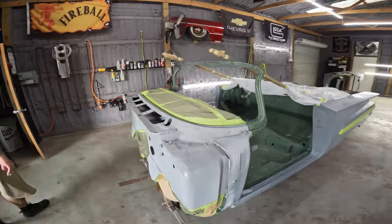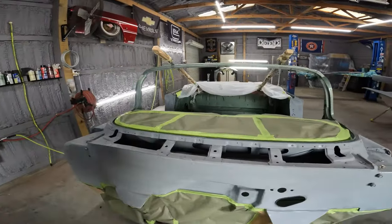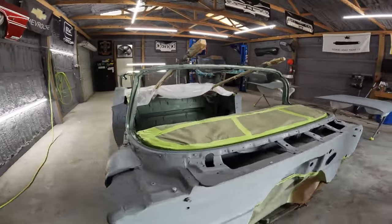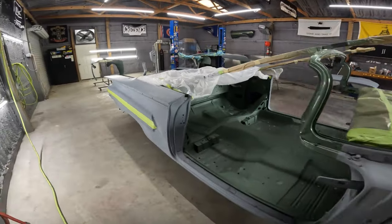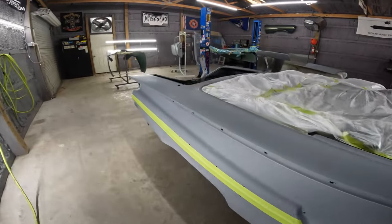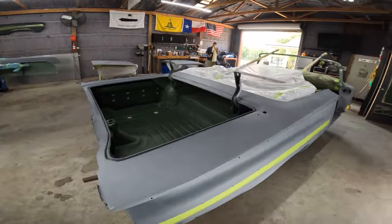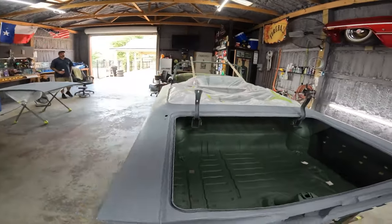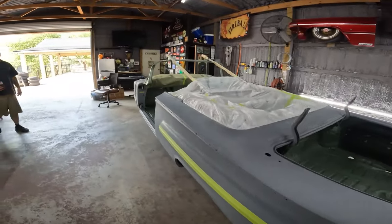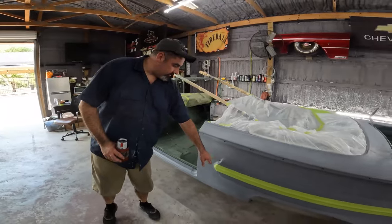It's a lot of work, man. This is a big car. This took all day. Used 3M 600 grit wet. Sunlight 400 grit wet. We used some of the black diamonds. We used some Durablocks, and we just freehanded some areas. Some areas you can get away with freehand, like little curves and stuff like that.